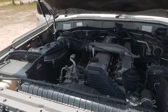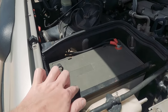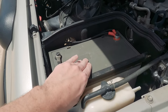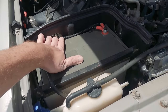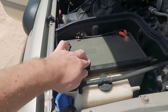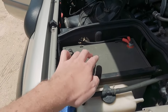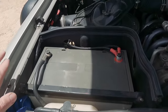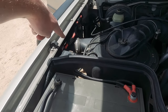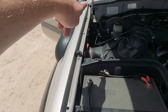Let's start with the engine bay. I got rid of the standard lead acid and found a good secondhand AGM that fits under the bonnet. It's not hot at all because of the heat shield, so it will be fine under here. I've wired the AGM battery in on this side and redone all the wiring — a couple of fuses, one for my DC charger and the other down to my power distribution board, which I'll show you in the rear.